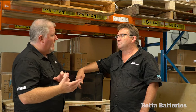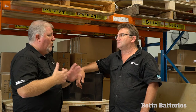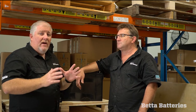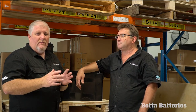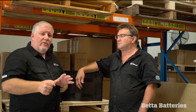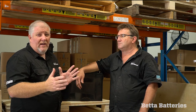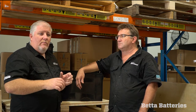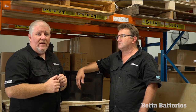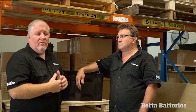You've recently increased your solar regulator size to a 60 amp MPPT. What I typically recommend for people with three batteries in a van and a small charger — a lot of vans might just have a 60 or 50 amp — is that you run the van off two batteries and put a marine isolator on the third. You've got to remember that a lead crystal battery after two years of shelf life will still retain 80% of its charge. By using just the two batteries you're closer to your charge current requirement, and you can latch in that third battery when you're off grid and camping. Every now and then just give that third battery a good charge cycle and it'll stay fine.